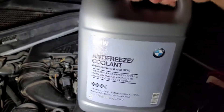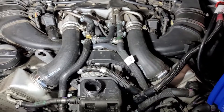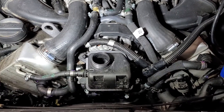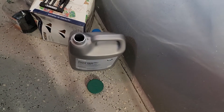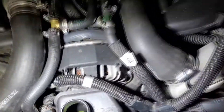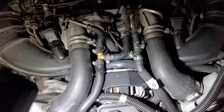This goes without saying — always use the BMW coolant. Don't take chances. It's not that expensive, even at the dealer — a little over $20 to $28 a gallon. Just buy it, get your gallon of distilled water, mix it 50/50. I ordered mine from FCP Euro — maybe $20 a gallon delivered. And antifreeze, unlike brake fluid, you can open it and keep it — it lasts.